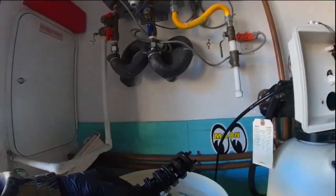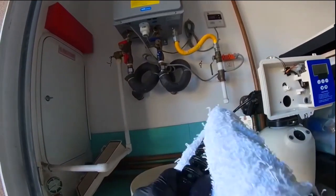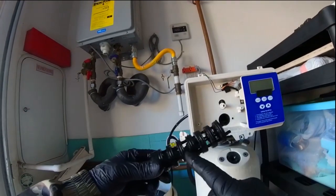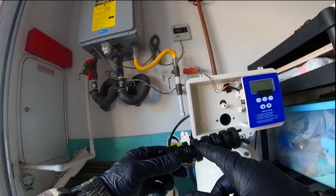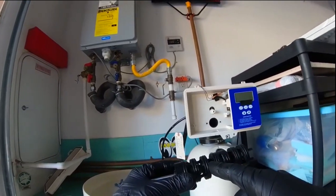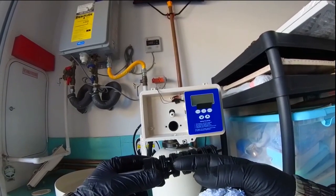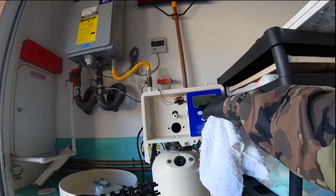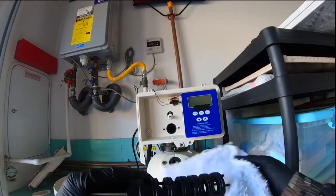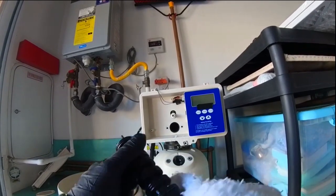This is what the brine piston looks like. Grab a rag and clean it up. A lot of the times this green part here — the inner shaft — if it's dry and there's not enough lubrication, it'll run dry, get stuck, and give you an error code on the display and the circuit board. So this is the surface that you need to address to get it working again.